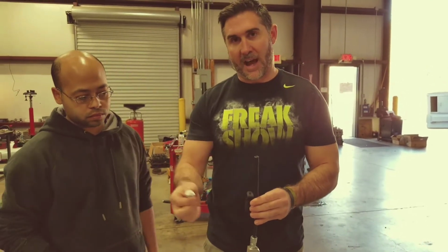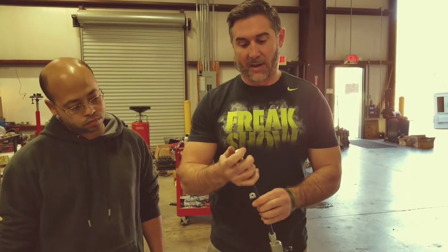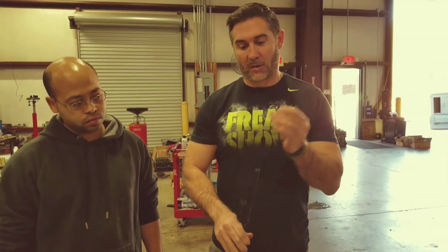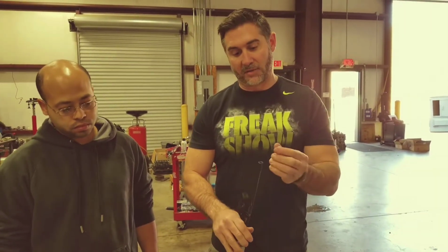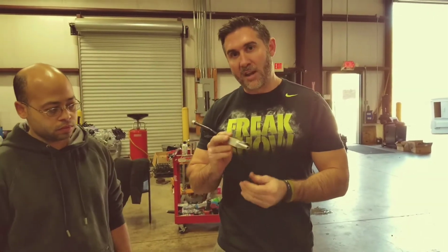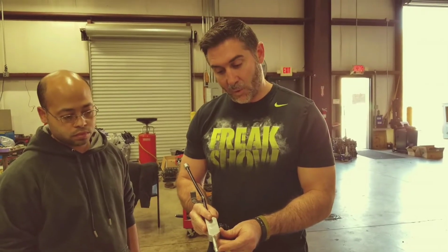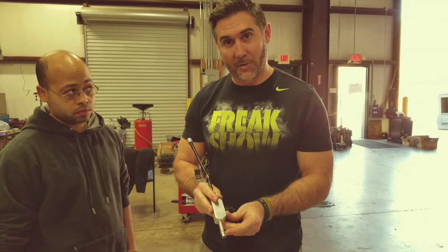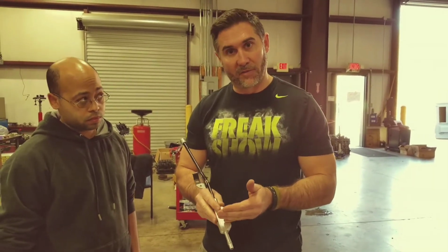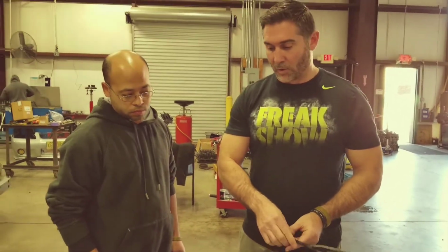So leave the dipstick out, and then we created this cap with the O-ring that goes in, and that stays always like that. When you need to check your oil, take this out, go get your dipstick, put it in, check it, take that out and put this back in. Make sure you never overfill your oil. If the oil level goes up to where the bottom of this is, you'll back up your turbo, all right? Always make sure your oil level is just below the full mark, okay? Otherwise, you're going to end up with some serious issues with oil backing up in your turbo.